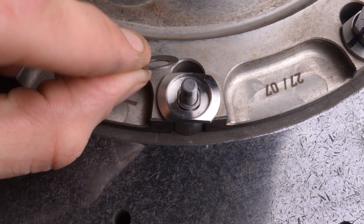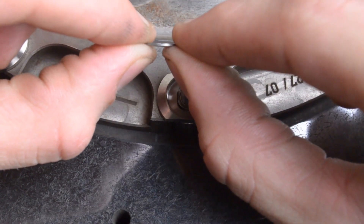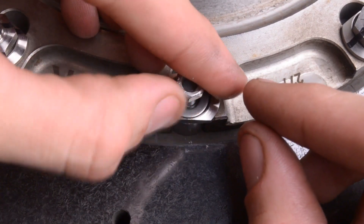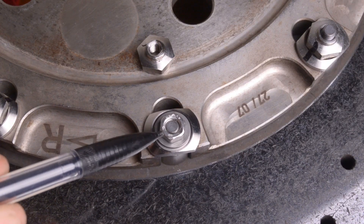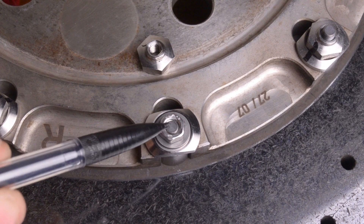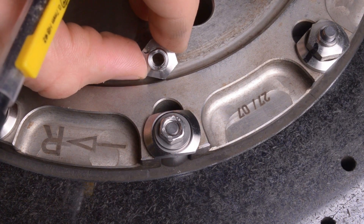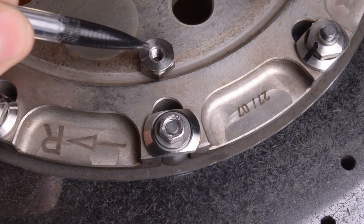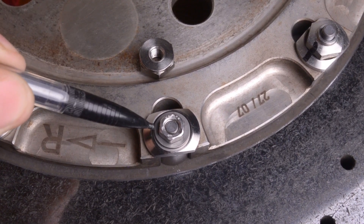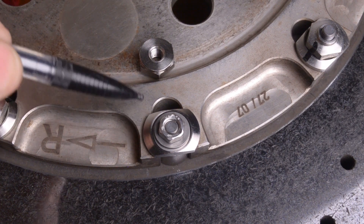We have a piece that applies pressure to the stainless steel hat but stays loose so it's independent of the two. We're going to allow for that preload using a Belleville washer. A Belleville washer is a little bit cupped — it acts like a spring. When you squish down on it, it deforms into a flat shape, but it wants to spring back into its original cup shape. We'll use another washer and a lock nut to deform that Belleville washer. The nut I put on looks different from Lamborghini's, but they both function the same way — both are all-metal lock nuts that can only be used once. At the top of the thread there's a deformed portion that prevents it from backing off during high-vibration cyclic loading. Instead of Lamborghini's specialized nut, I used a flat washer with off-the-shelf components to achieve the same mechanical properties and the same amount of preload.